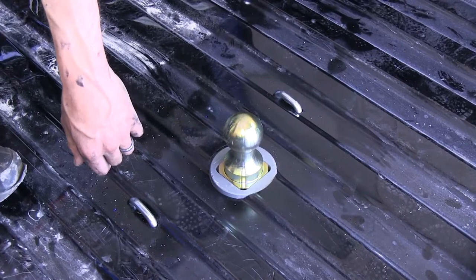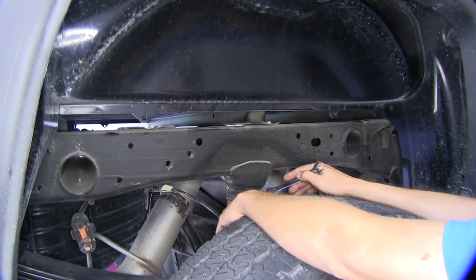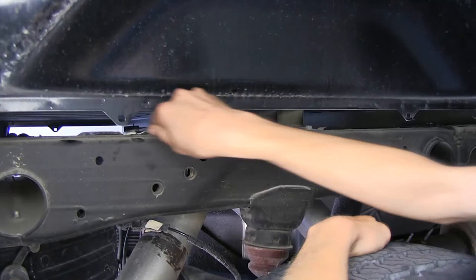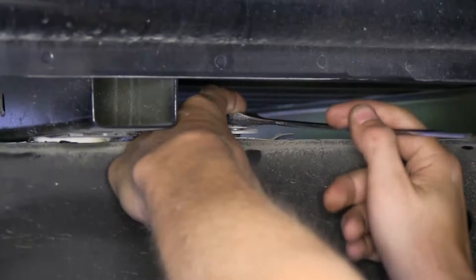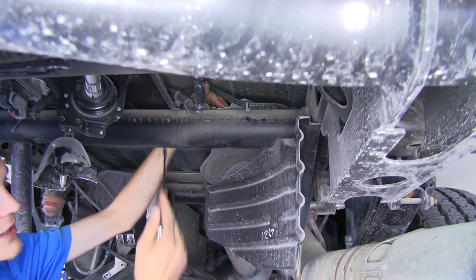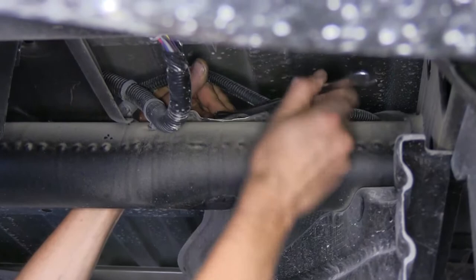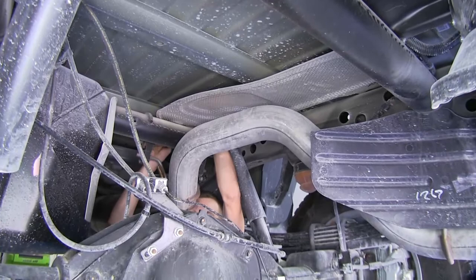We find ourselves in our passenger-side rear wheel well. We need to remove our exhaust heat shield right here — there's a total of four bolts that hold it in place. We can find two of those on our frame rail; these are 13-millimeter bolts. We can discard these bolts once we have them removed — we will not be reinstalling the heat shield or the bolts. Our third bolt is right here on our cross member right to the front of where our spare tire hanger is. We did remove our spare tire earlier just to make it easier for you to see. Our fourth and final bolt is on the front cross member just at the rear of our fuel tank. Now we can grab our heat shield, slide it out, and discard it.